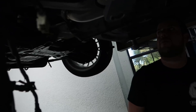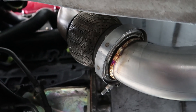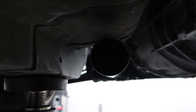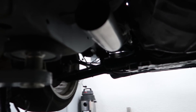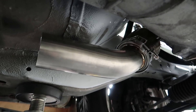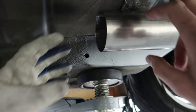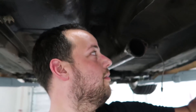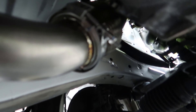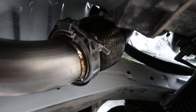Madman fabricator is on his A-game today — got some pretty looking welds up here on the new piece connecting to the downpipe. It's really tucked up there, which is great because on these cars when it hangs down low you're bashing it on everything. We also converted this to a V-band flange since we didn't have the three-bolt flange, and it's way nicer to work with than the three-bolt.